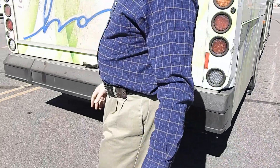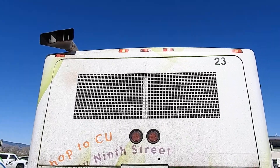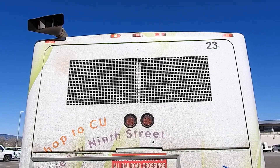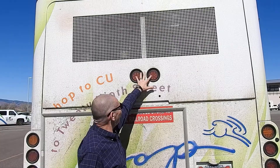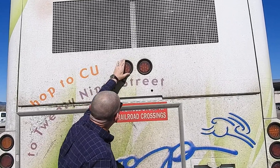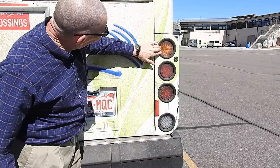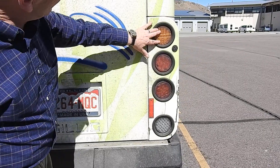At the rear of the bus, I've got five red clearance lights on the top — they all appear to be properly mounted without cracks, and they also have reflective units on those lights. In the middle, there are two red brake lights. The lenses are not cracked or broken — they're dirty but the seals around them are intact. On each side, I've got turn signal, brake lights, and tail lights — checked and confirmed properly mounted.